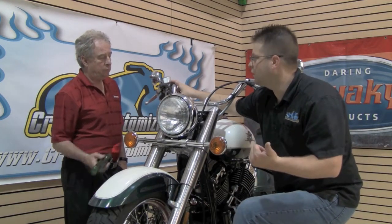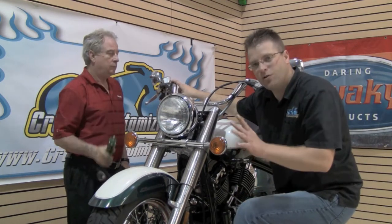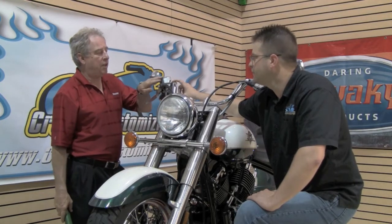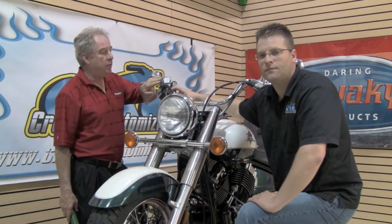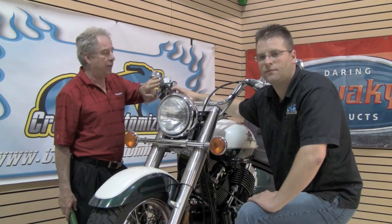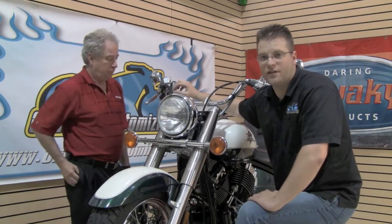The next thing we're going to take a look at is the fluid level inside the master cylinder. What color is it? If it's not clear, then it's got oxidation in it and it needs to be flushed. This one here is turning a yellowish color, so we're definitely going to need to bleed this system. And it looks like it's had a leak before because a lot of the protective coating on the aluminum is worn off. That generally means that at one time this had a leaking gasket up here and was ridden with a leaking gasket. Stay tuned for one of our tip of the weeks where we chrome out these bars and you're going to see how you can cover up an ugly eyesore like that.